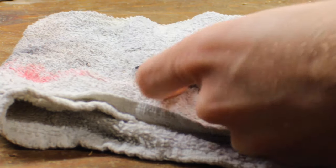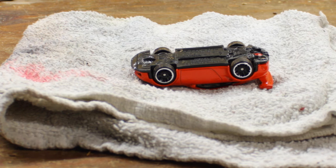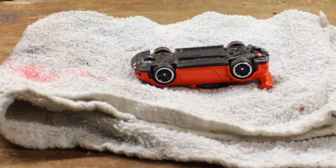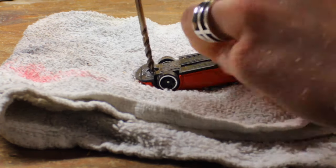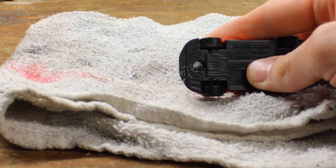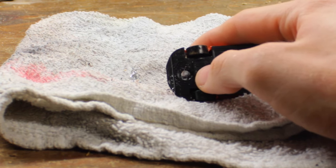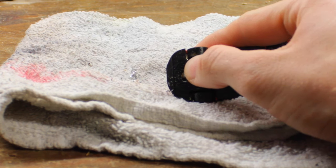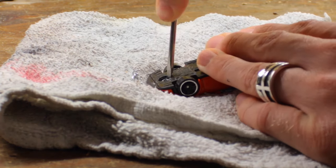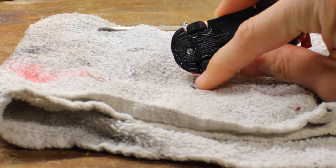Then I come through with a bigger drill bit and actually drill the head of the rivet off. Here's what that looks like. Now that I've got a good pilot hole started, I'm going to go ahead and get my bigger drill bit and drill the head of that rivet off. Remember, whenever drilling, it's not about how fast you're going — it's about pressure. Now this rivet didn't come out perfectly, and I'm not going to act like every single one of my cars comes out perfectly. Usually what I do is there's still a little bit of a lip left on the top part of the rivet — I take a very small screwdriver and pry it off. And that was what was left of the top of that rivet.